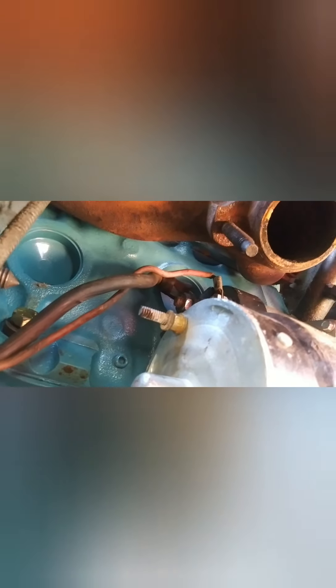Something to remember: when you're clocking and torquing the battery cable, before you connect any battery power, you need to make sure you can see that you're not pushing that battery cable up against the block when you tighten the starter. That happens a lot. Sometimes once the bolts are in the starter, you can pull and bend the tang on the cable so it'll fold back. I've got clearance so it is not hitting, but needless to say, you've got to check that before you put power.